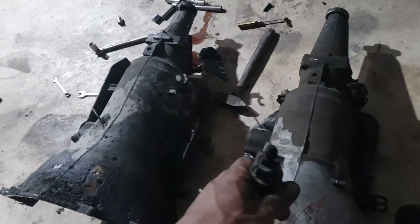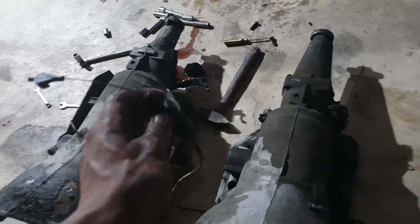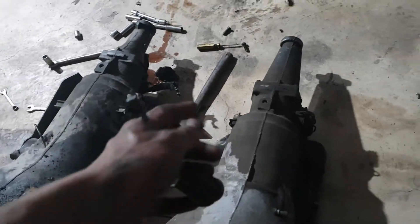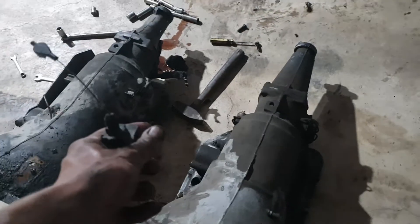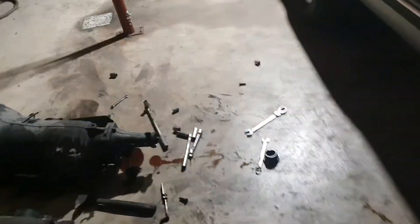There's a TV cable provision on the 700R4, but on the Turbo 350 it's just a kickdown cable — it doesn't control the throttle valve. That's done through vacuum actuation via a vacuum actuator. Since this is a 4L60E it didn't have a TV cable, but there's a little bracket with a hole for it, and there's the extra knob right here. So the kickdown cable should clip right in and kick down through the gears just fine.